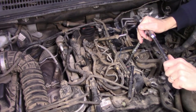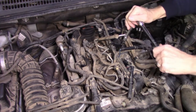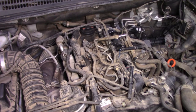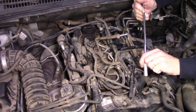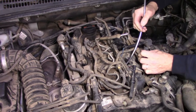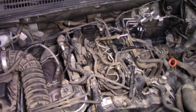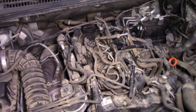Let's try the second one — beautiful. Glow plugs can be a pain in the butt or they can come off nicely. In this case I don't have to put any tension on there whatsoever — very nice indeed. You might need a magnet to get those out because they're in there so far. By using a glow plug removing device better known as a magnet they should be able to be pulled out — that's my theory. It's obviously not steel though, so the magnet doesn't work. Have to get them out with a pair of pointy nose pliers. There's number one — that's had a bit of a hard life. I'll lay these out in order.